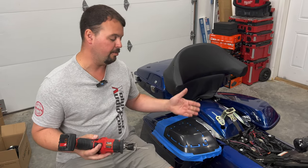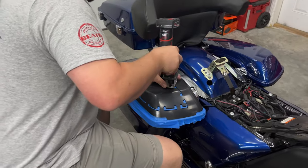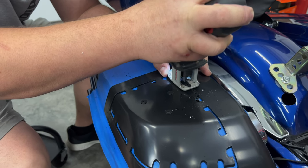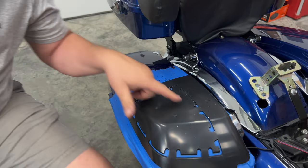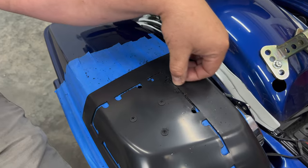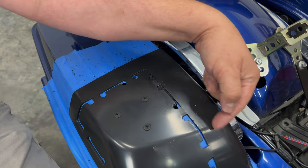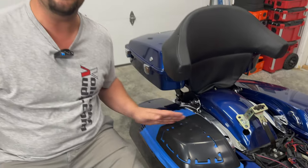We're just going to drop our blade into the hole that we've pre-drilled and start following this pattern. As you saw, I dropped into this hole and I tried to follow it as straight as I can. When I get to these little plastic areas, you're just going to cut straight through them. When I got to the corner, I just did a straight cut and stopped. You definitely want to stop — don't go too far, because under here is the latch cable that comes out to our lock mechanism. Definitely don't cut any further than what you see here on the end; just go to a 90.